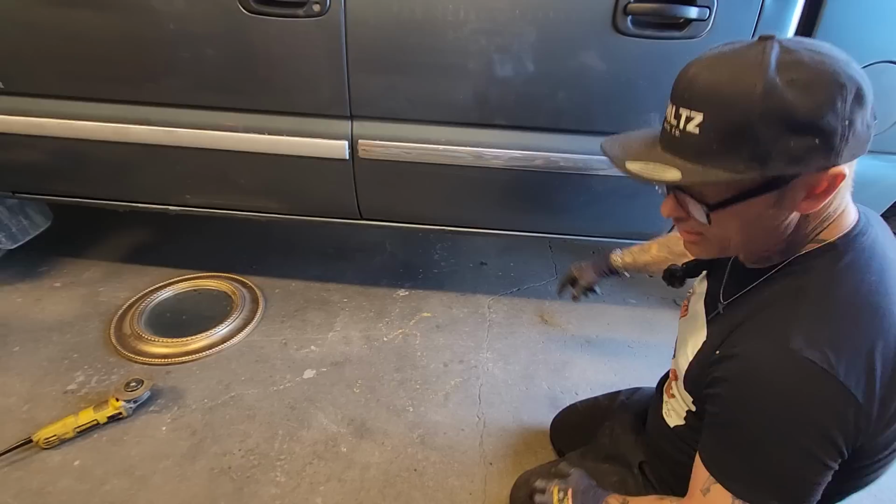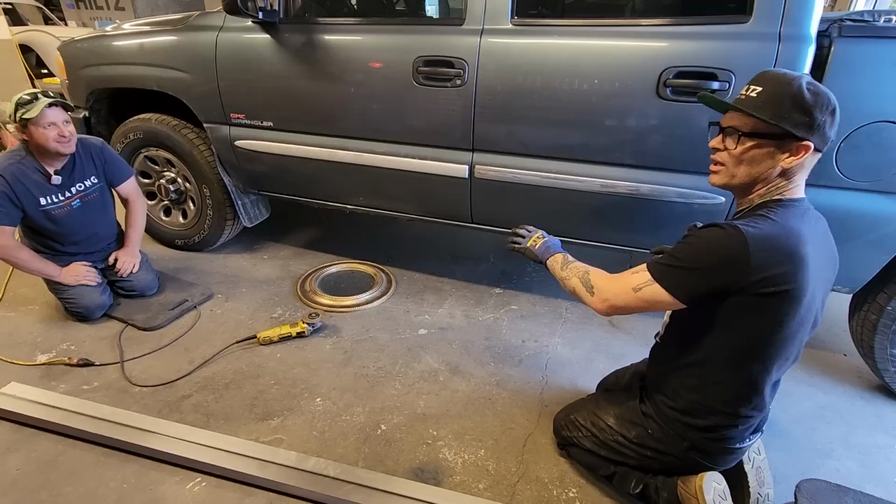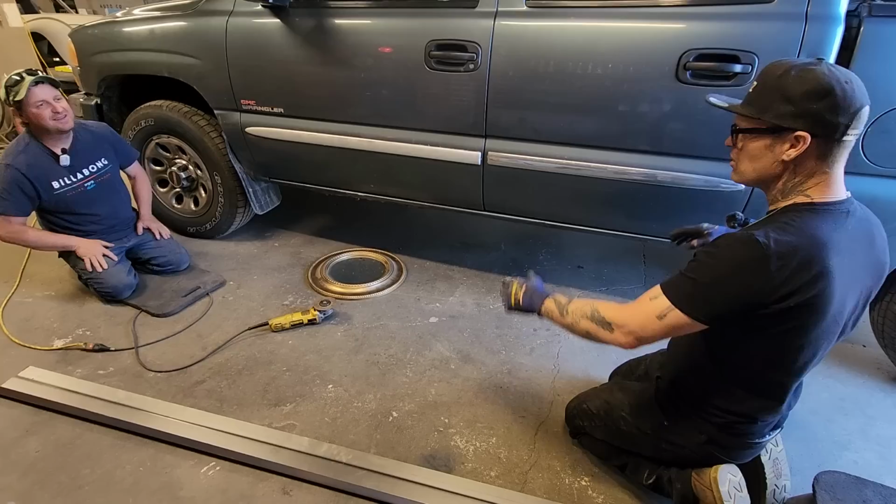And then we'll go on the inside and tack that piece on so we can lay that right on top of that. One thing we will not do, so get ready, when we cut it off, we will not undercoat it before we put it on. We will not do that. Undercoating is last. So when you get your car all fixed and we get the piece on, then the undercoating goes on.